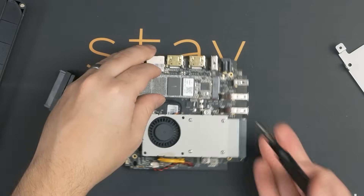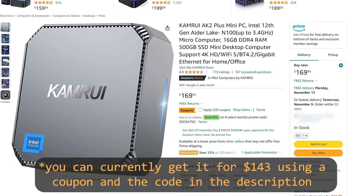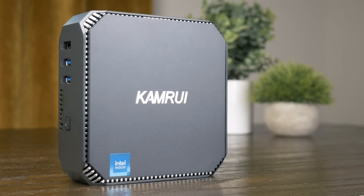The AK2 Plus Mini also comes with 16GB of DDR4 SODIMM memory, as well as a 512GB M.2 SATA drive. There's only one slot for memory because the N100 only supports single-channel memory, so having a second socket doesn't really provide much value. This features a SATA M.2 drive instead of NVMe because these have to be affordable somehow. The AK2 Plus Mini currently costs just $170 and has been available for even cheaper — the only way this is really possible is for the manufacturer to cut costs where they can.